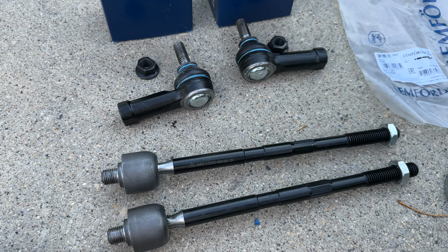Now, my plan here for the leak. As I've mentioned, I haven't added any oil all those years, so I suspect it's an old oil leak in the boot. I'm gonna install a temporary plastic zip tie. I'm gonna drive the car for a month or two, open the zip tie, and check for any fluid in the boot. If everything is okay, I'm gonna just reinstall the OEM metal clamp. So that's the plan.